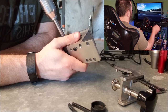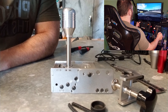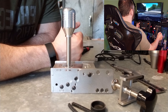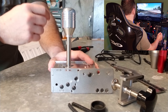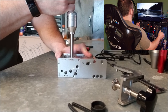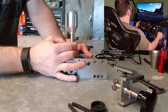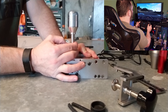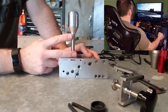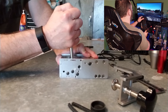and that is the rod length. I think they actually picked a really good rod length here, and I've seen some old pictures of rod lengths maybe being longer or shorter. Shorter gives you a little bit more torque feeling on it, and longer is obviously going to make it weaker because your lever force is much higher up. If you're grabbing it up here, you're going to have a lot more leverage, and it's not going to need as much force. As you get down to the base, if you were to grab it down here and make a shift, it requires quite a bit more force to make that shift. This is a good compromise, a good length, I think, as far as what'll be a happy medium for most people, right?